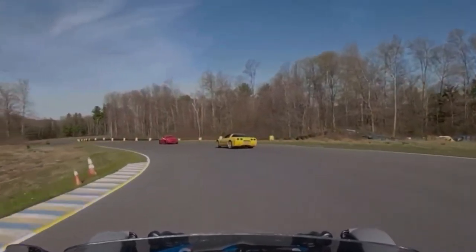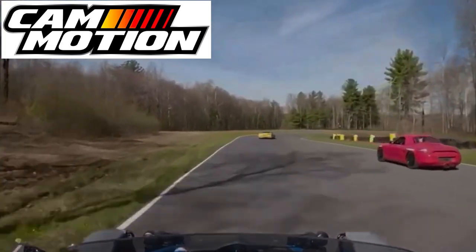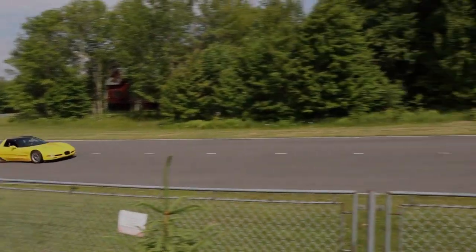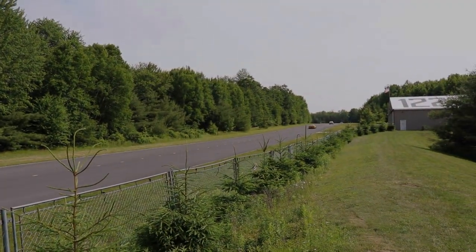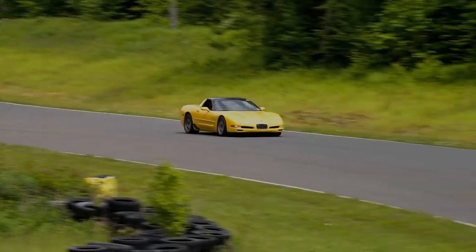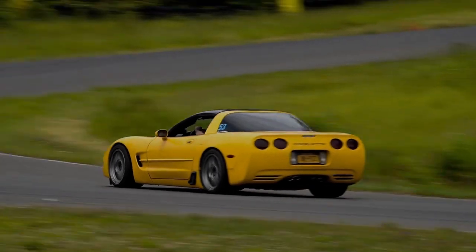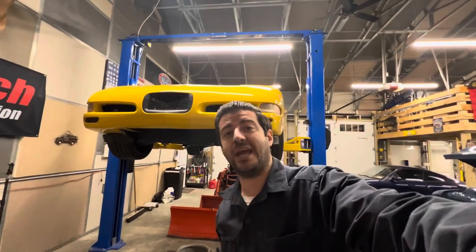It's about time for me to upgrade the cam on this car. I partnered with Cam Motion and we spent a lot of time together putting together the perfect track cam for my C5 Corvette track car. It's designed to make a ton of power between 3,500 and 5,500 RPM, which is where I find myself most often on track, but it'll still be able to wind out to 6,500 RPM. I'm not going to get as much horsepower increase over 6,000 RPM as I would on a stage 3 or stage 4 cam, but I'm going to get a lot more torque and power down low coming out of turns. If you're interested in this cam, I'll put a link in the description below.